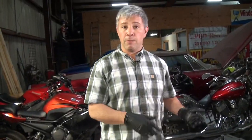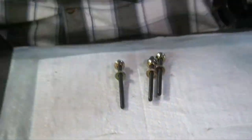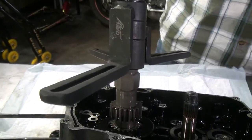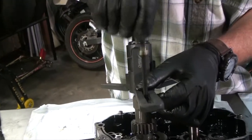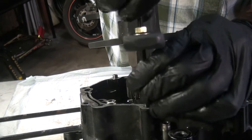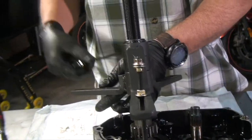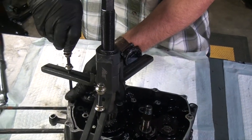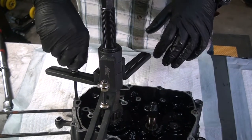Now that's applied to the engine. First we're going to take the three-arm puller and slide it over the crank itself. You're going to take your small bolts, which are still long, and put them into the crankcase themselves. We're going to make sure that we triangulate the three-arm puller so that it pulls evenly and distributes the pull from the crankcase across all of the crankcase cover.